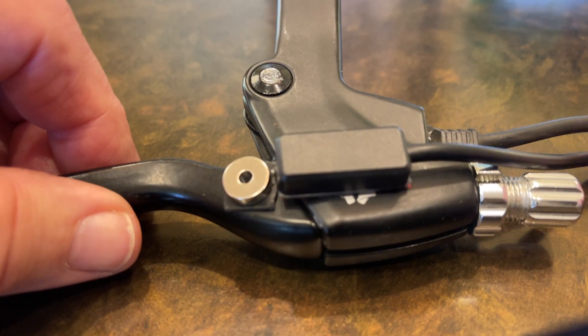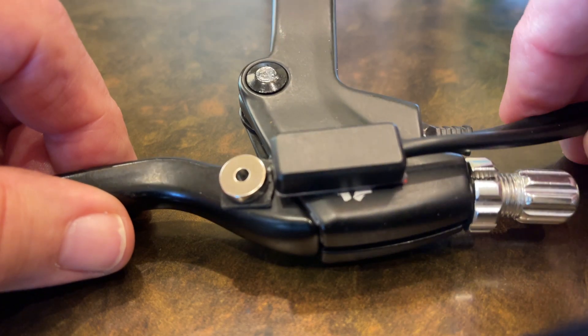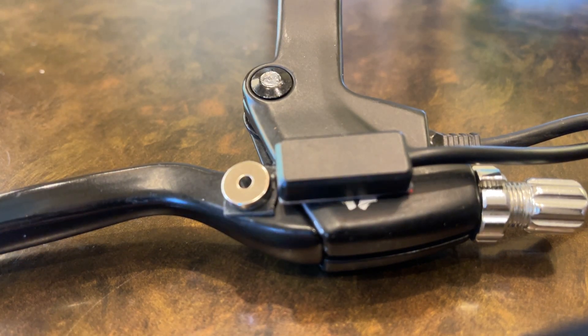You can zip-tie these things down to either the brake cable or to the other shut-off switch. That can be connected through with some DIY cabling and connectors to the power that's going to your taillight or headlight, and then eventually routed to a second taillight which becomes your brake light. It's not the only way to do it, but it's the easy way to do it without endangering your controller circuitry or changing anything that the electric bike has designed for the motor cutoff switches to work properly.